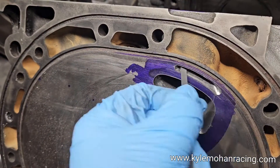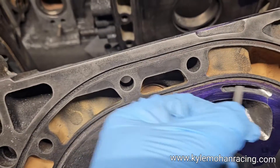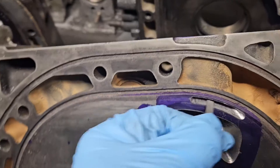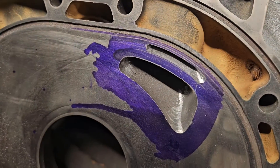Work all your directions, cross-hatch. Cross-hatch removes the lumps, removes the bumps, smooths it out. You can even see my bad left-hand file job — I'm pulling some cast iron away and smoothing out that port.